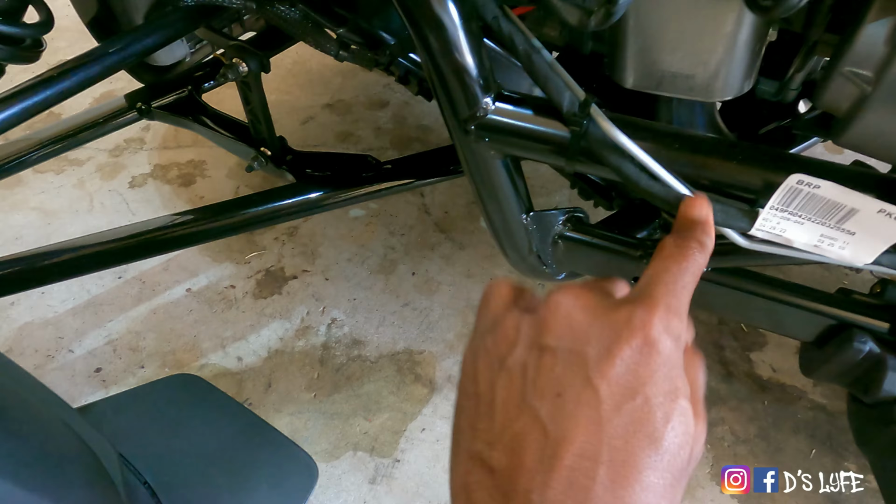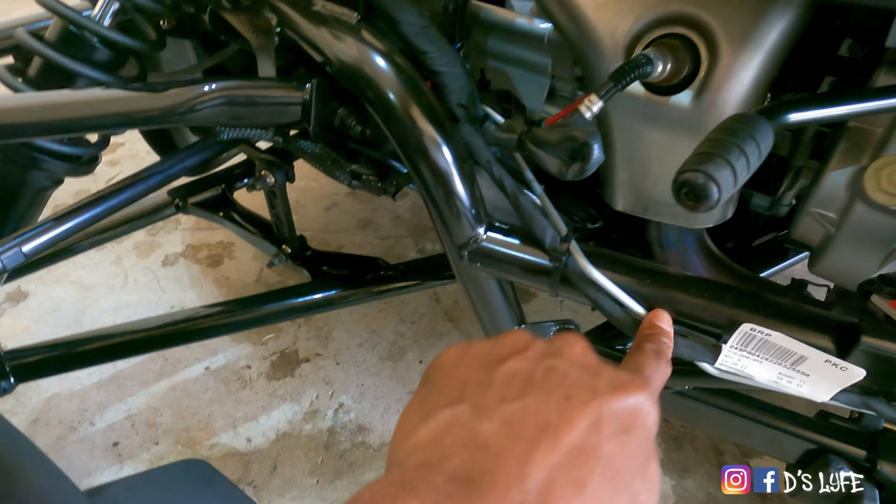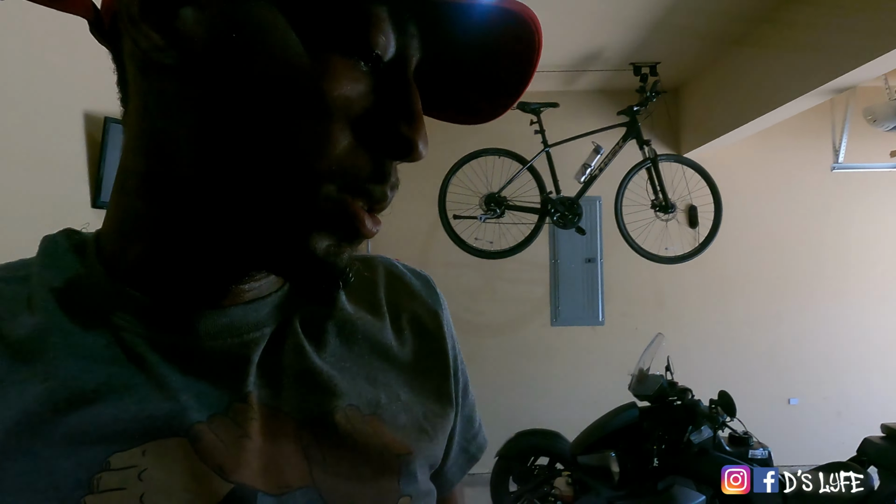But yeah, tap into the white wire here, and that should be my brake wire, because apparently this kit, even though it's an LED kit that you can change the color on, has this feature: if you hit the brake light, all the LEDs will turn red. So that's the reason why we need to tap into the brake wire. So we're gonna start getting some of this stuff wired up, do our first test. If that's working, we'll start cleaning up the areas that we're gonna put the lights in, and then we're gonna be done. So stay tuned.